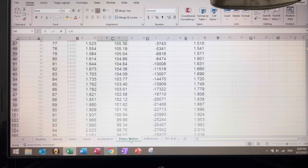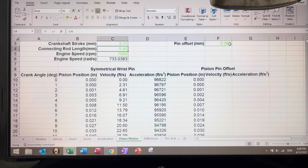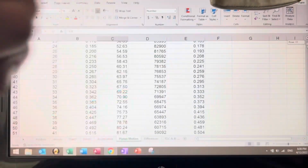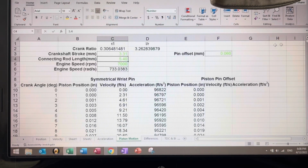So what does that tell you? That tells you that the 60 thousandths of offset going with crankshaft rotation, which is the version of the flipped piston, like Smoking Unix said, as the engine picks up speed and starts to go down compared to the 0 offset, 267, 259, this one has traveled less down the bore than the 0 offset.